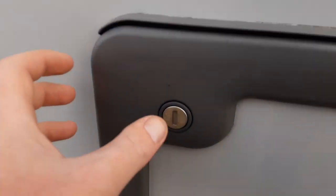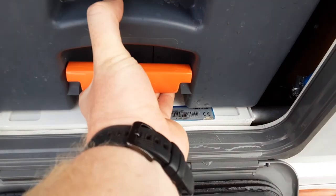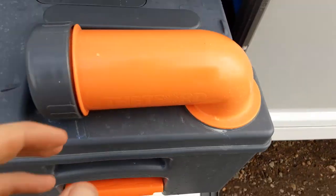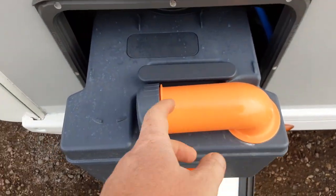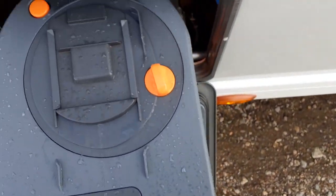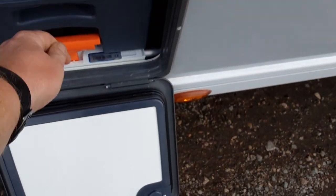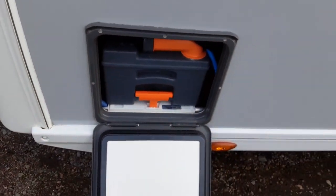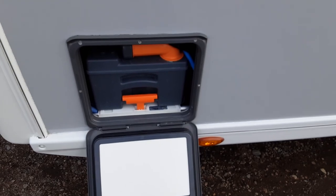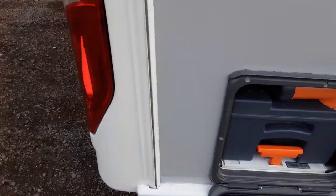On the back of the caravan you have your toilet flush tank. To release it, pull out the orange handle from the side of the valve and pull the cassette towards you. The neck here turns out. You've got a measure for your blue fluid on the back, and an orange pressure relief button — press that as you're tipping the waste away so it doesn't spit and splatter back at you. In the cassette you'll need to put one litre of water prior to use and a capful of blue fluid.